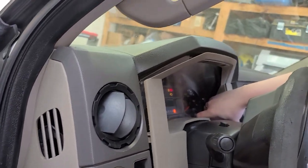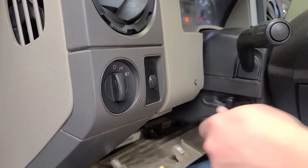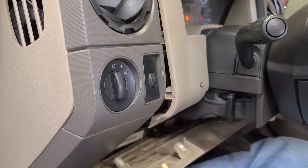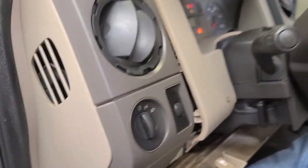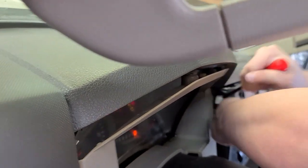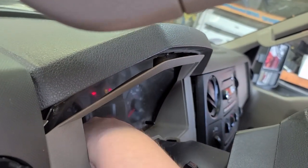Do be careful - there's one of these little lights here and there should be a wire on the back side of this, so do not pull too hard. There's an aftermarket alarm on there, so that's probably not a standard feature on those doors. Sometimes you do have to pry it up on the side of the radio just to get a little extra clearance at the bottom.